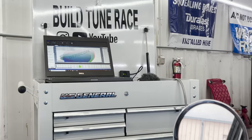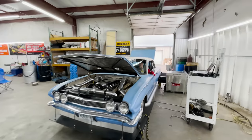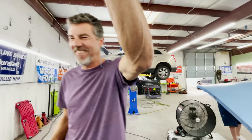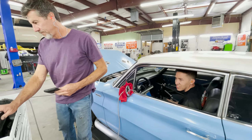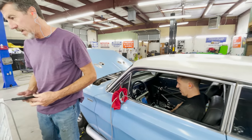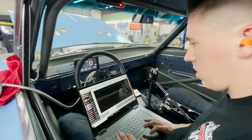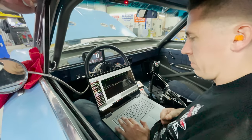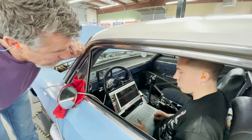1,411 horsepower! Let's go — 1,411 horsepower right there. That was easy. It's nice to just be able to come in and plug numbers in and let it do what it does. This is the easiest dyno day ever. That was right at 7,200 RPM and made 24.8 pounds of boost on that pull. So that's comparable to where we were at through race week — we were making like 23 pounds down track and that was 24, so a little bit more. That's probably an 8.40 pass with a good 60-foot.